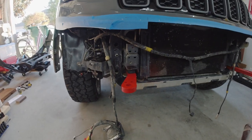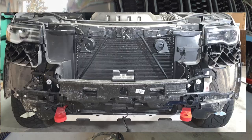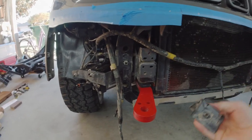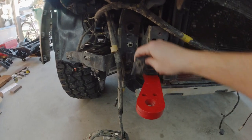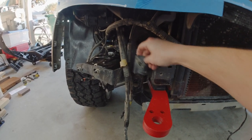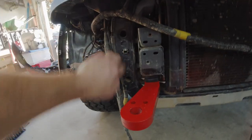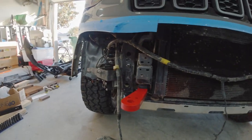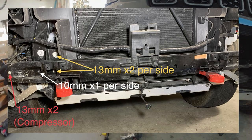Some of the install steps I won't be able to show since I already had the hidden winch mount in here. Pretend there is a crash bar right here. These two 13mm bolts on both sides come out, and this bracket — which is just a 90-degree bend that went into the crash bar — you can wiggle those off. Both of the 13mm bolts in the radiator brace also have to come out. In total you should have four 13mm bolts: the two here are shorter, the two long ones are a bit of a pain to get out but they have to come out for the mounts.